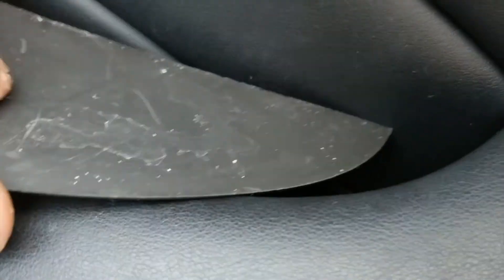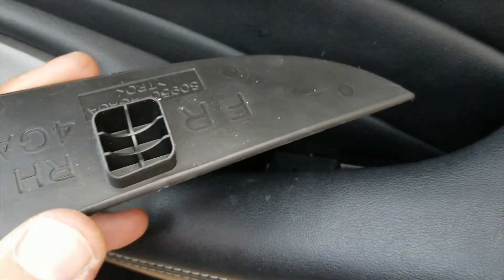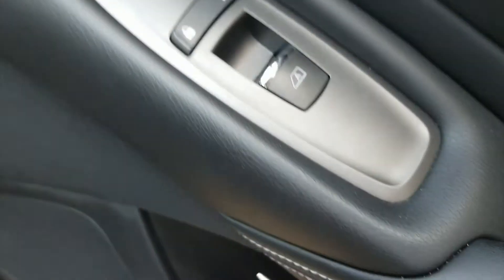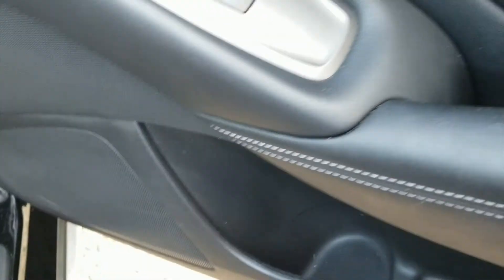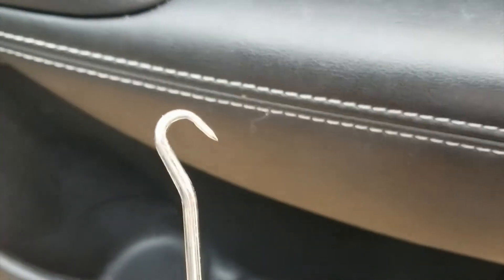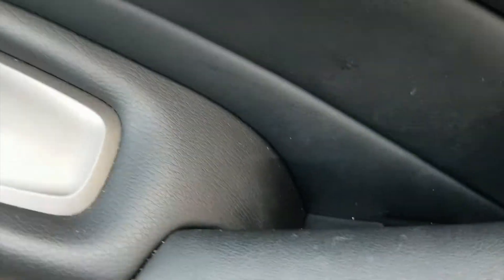This piece is very tight — it slips right in there, hiding that screw. It's just a pressure fit, no clips, nothing — just pressure fit. I could have used the pick again but I use this hook tool. It's a bit dangerous since there's leather right there, so if you don't have this tool I don't advise using it. Be very careful how you put it in and flip it up toward you.